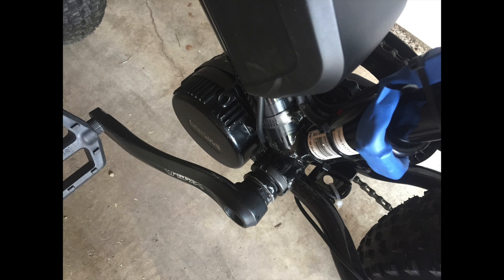I torqued the two together, put a toothed lock washer in between them, added some epoxy, and then cranked them down using the normal crank bolt. It seems to work pretty well, though it took me a while to find this solution.